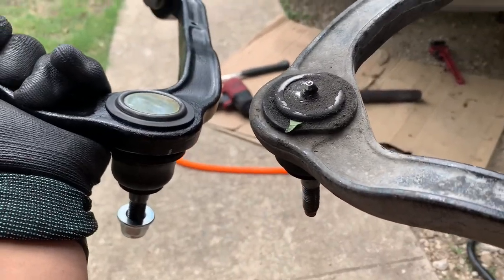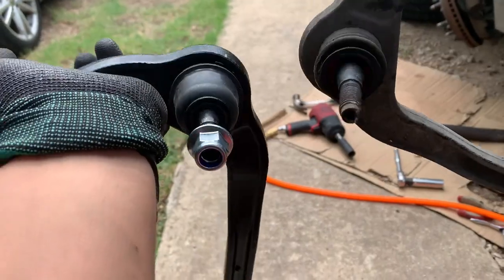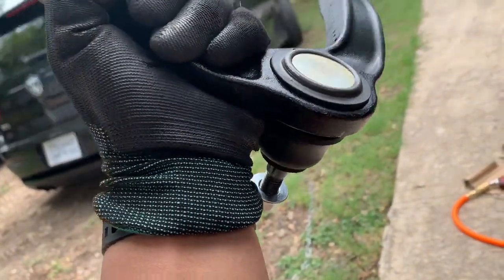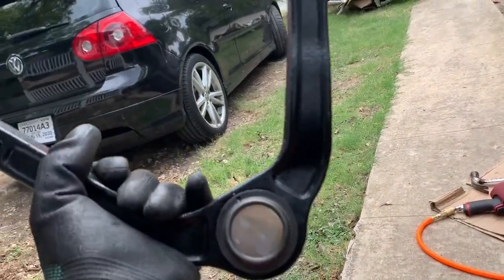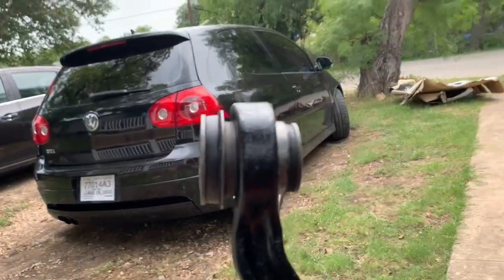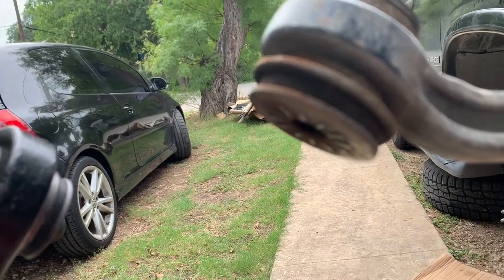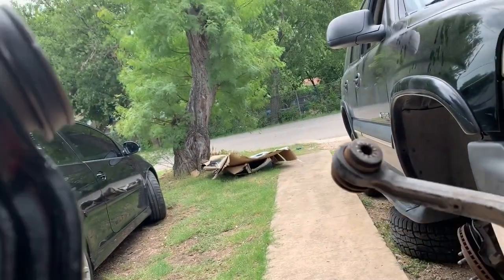See the difference between the old one and the new one — the new one doesn't have the fitting for the grease, so I'm kind of upset about that because how am I supposed to fill this? I'm gonna have to get a new ball joint every time. It feels good quality, the bushings are — I mean these aren't terrible, but that one's busted, so it'll give you play in the suspension.